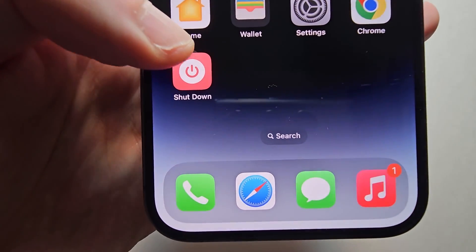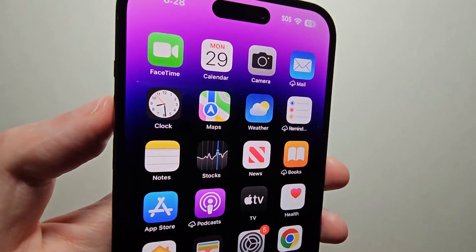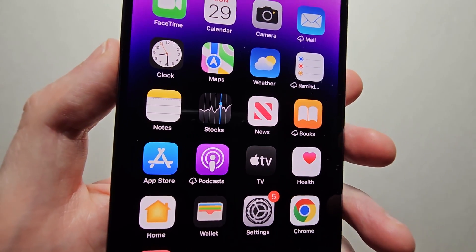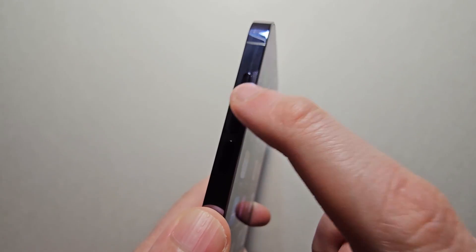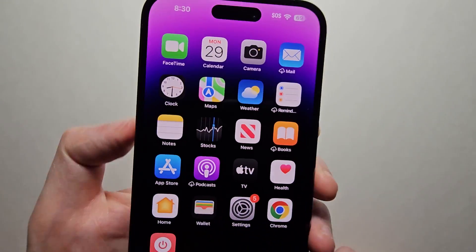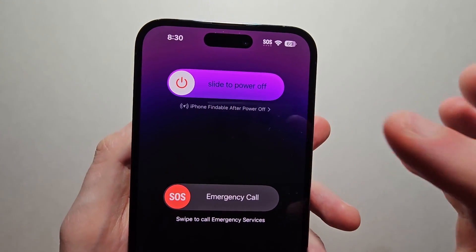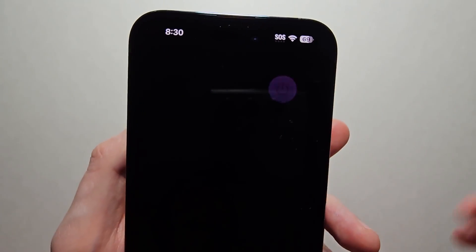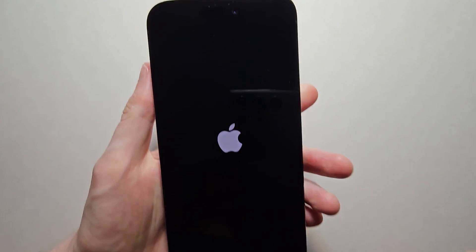One of the ways is how to get the shutdown icon. For the first way, you're going to hold down a couple buttons — hold down volume up and at the same time hold the side button. And once this comes up, just swipe right. To turn back on, just hold the side key — not the volume — until you see the Apple logo.